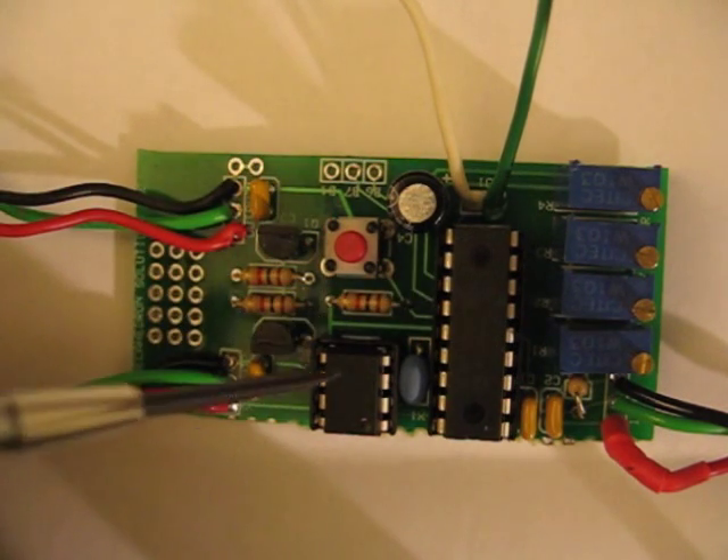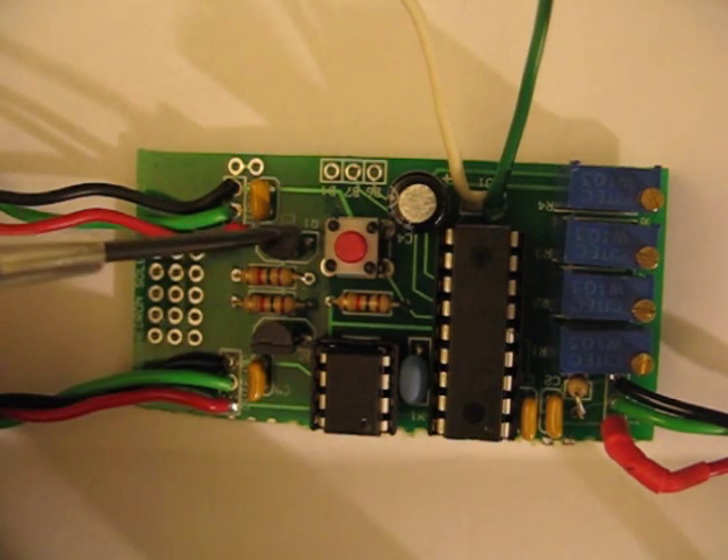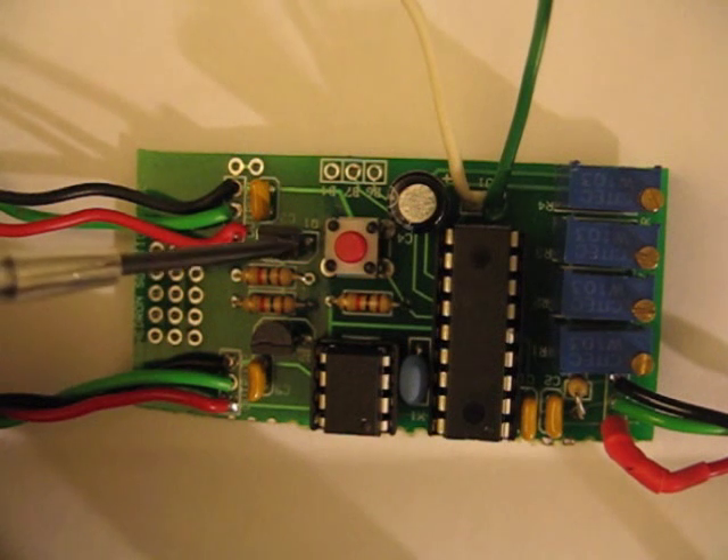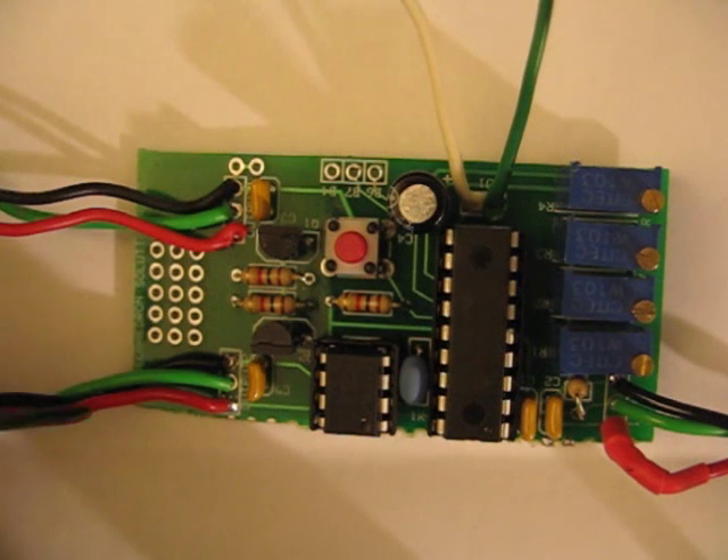The ICs do come socketed. This is a digital potentiometer. And then I have two emitter follower BJT NPN transistors set up so that you can actually get dual throttle output, and they match quite nicely.